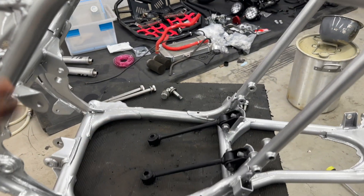We are back in the shop. What have we gotten done to the 03 today? Basically I've got the arms and stuff taken apart. I think tomorrow I'm going to take out the zerks, get the bushings and inserts out, take the caps off, and work on getting those blasted so we can get them cleaned up. Over here we look the same, the swing arm area still needs to be broken down. I do have some progress going though, so don't think I haven't done anything.